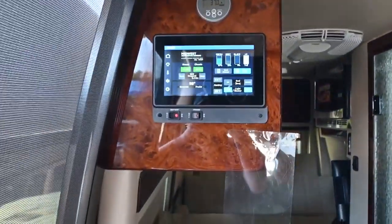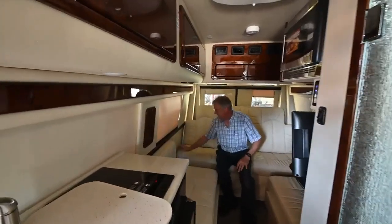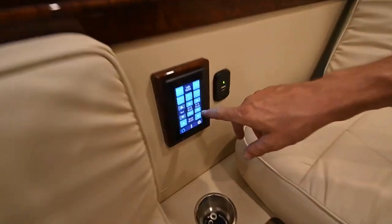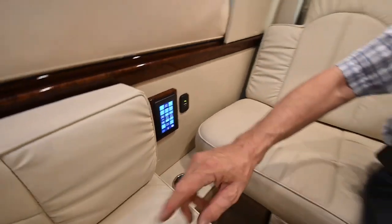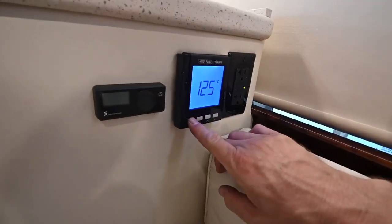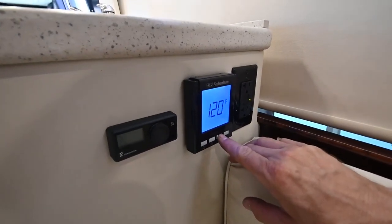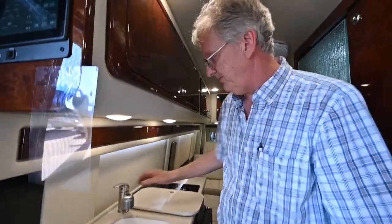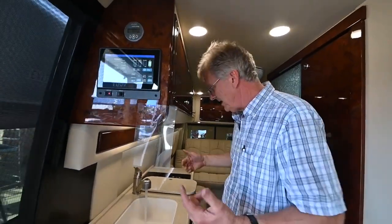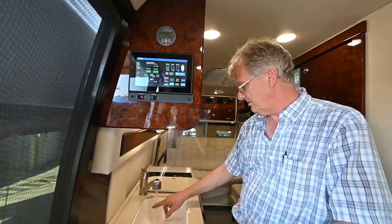If I want hot water, I have to turn on the water heater. The water heater is turned on right over here on this side. This is the Suburban water heater controls - it's off, I'm going to turn it on. I've got it set for 125; you may not need it that hot, so I'm setting it for 120. When we turn on the water, the water heater is going to light up on LP. It's got to go through the pipes and lines before you'll start getting hot water at your faucet. As long as you have LP and water coming into the water heater, you'll be able to take those long showers.